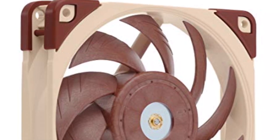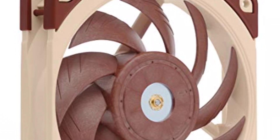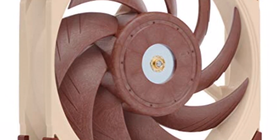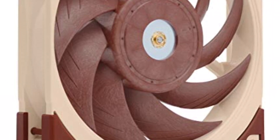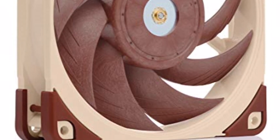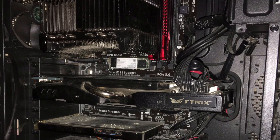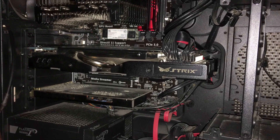Hi, I'm Nathan Oakley. To make my aging five-year-old PC run a little cooler and quieter, I upgraded the existing PWM fan, which was 18 centimeters, to a 20 centimeter PWM fan from Noctua, and also added a 12 by 25 PWM fan, which you can see on screen now. The passive cooler had an 18 centimeter fan blowing over the entire PC including the graphics card, which didn't run at low load, and a passive power supply below.